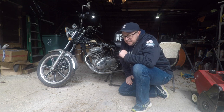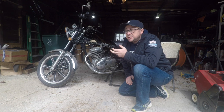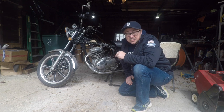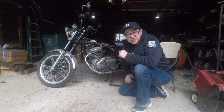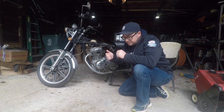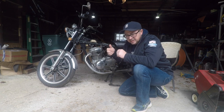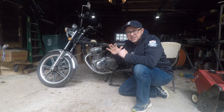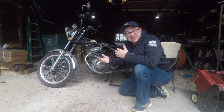And then with the help of a friend of ours who used to race, we diagnosed it as a problem actually in the carburetors. Even though the carburetors had probably been rebuilt 3 times since I've owned it, there's still a problem with the carburetors. And how we figured that out was when the right cylinder wasn't running, we stopped it, pulled the plug out of the right cylinder, dropped a couple drops of gas into it, put the plug in, and fired it back up. Boom, ran awesome for about 7 seconds. And then it fell off. So what does that tell you?